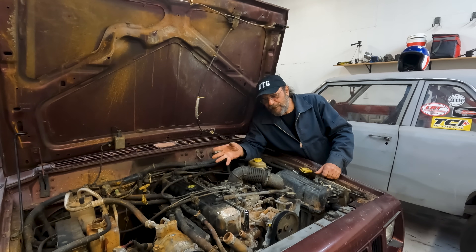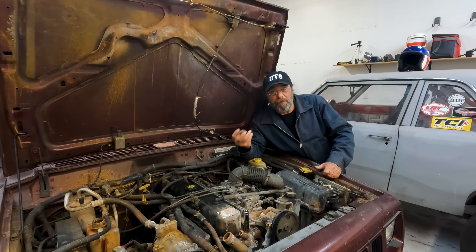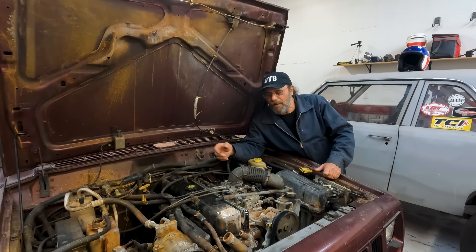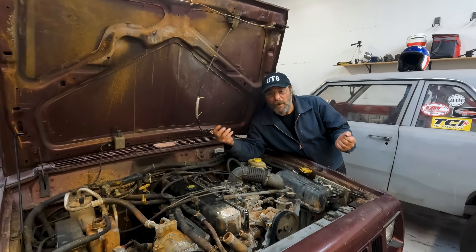After just a short period of time, I realized it had serious cooling system issues. It would occasionally overheat, there was no antifreeze in it — just rusty mud muck. The previous owner had been pouring bottle after bottle of sealer into it. So it became obvious that I was going to have to flush the block and go through the entire cooling system.